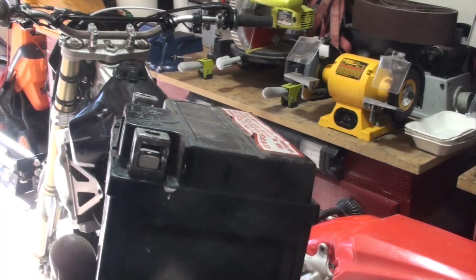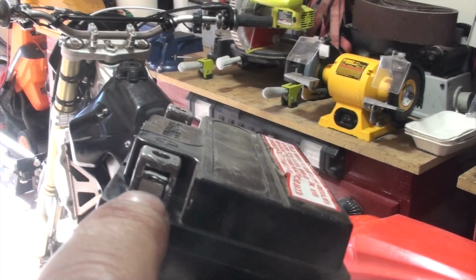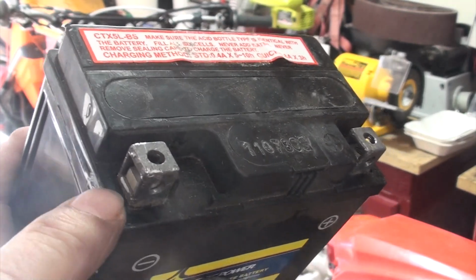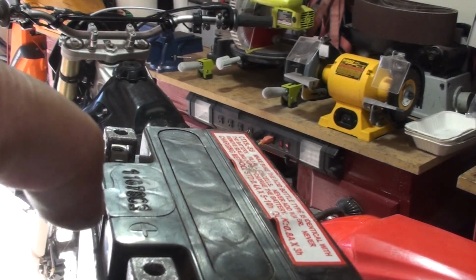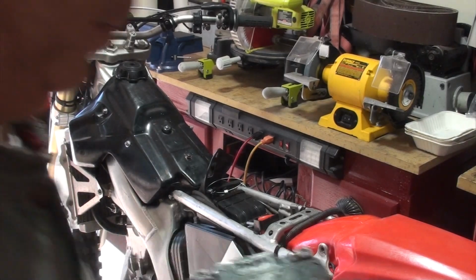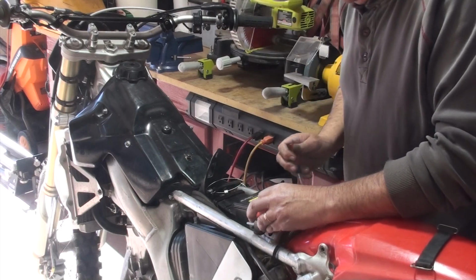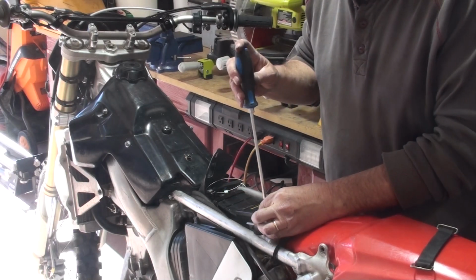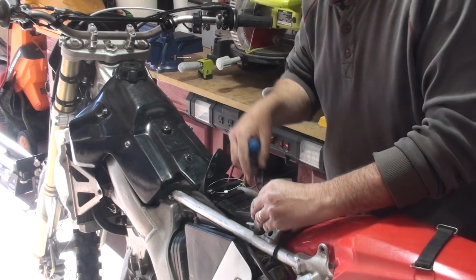So we're going to hook up the battery. Something I thought I would share with you that I learned, not in these videos, but other ones. There's a nut in there, and a nut only fits in a certain way. Same thing on positive and negative side. You'll see some white around there. That's just a little bit of grease that I put on the bottom of it to hold it in position. So when I go to put the screw in, it will capture it. I won't have to finesse with it. So here we go. Positive first. Okay, I can feel it grabbing it. Awesome.